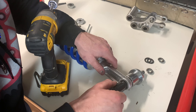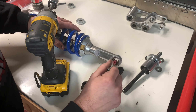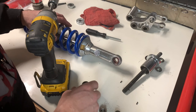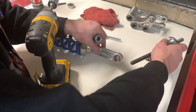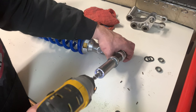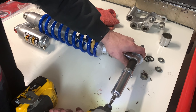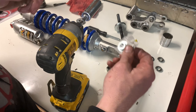I'm going to try this. That one seems like a good size because it fits right on that race. This is no man's land — I've never done this, it's probably a terrible choice. Let's see what kind of terrible damage I've done. None — looking good. The other one's almost out. If you're going to do it this way, I recommend putting grease in there to hold the needle bearings in a little better. It's a learning experience. I'm going to push that in a bit further and knock the other one the rest of the way out. Worst case, I got to go back in and push it back the other way again to center it. Don't advise this at home, but part of motorcycle repair is just getting creative.